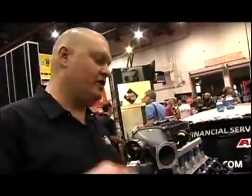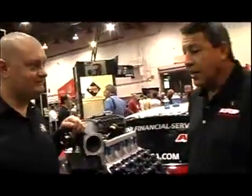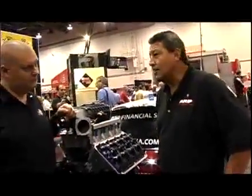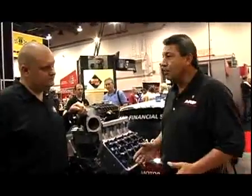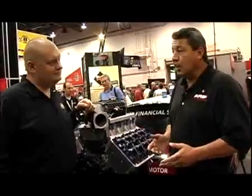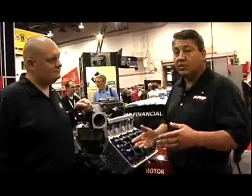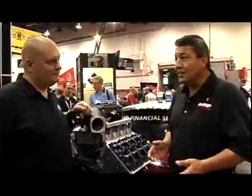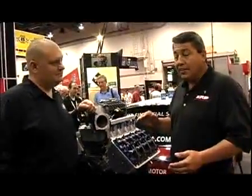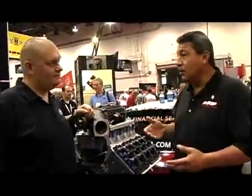We're talking about the lubricant we use when we're putting fasteners together in the engine. So why not just grab a bottle of engine oil? Engine oil is probably one of your most inconsistent lubrications for a fastener. If you're trying to achieve, say, an 18,000-pound clamping load, we can formulate it with ARP Ultra Torque and say it's going to be 120 foot-pounds of torque to achieve that. If you use 30-weight motor oil, your first pull you might be down around 14,000 pounds, and it could take you seven or eight pulls to get to that desired 18,000-pound clamping load — and then it might rise above or fall off depending on galling or other friction.